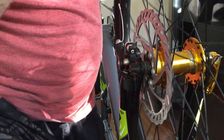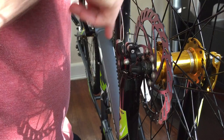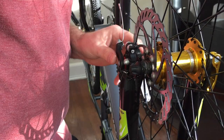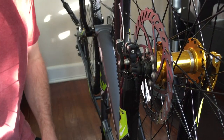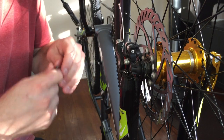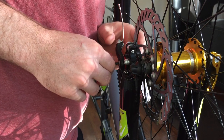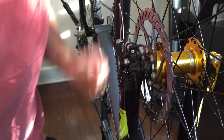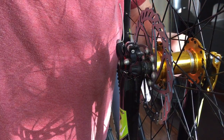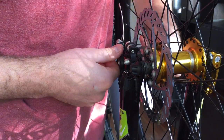It kind of seems like it's okay. If you look straight down, this is the caliper — the rotor spins through it. If you look straight down you can kind of see which side is closer. All you want to do is take the allen key — actually it's the other side — take the allen key in this side and just back it out ever so slightly, maybe like a quarter turn.